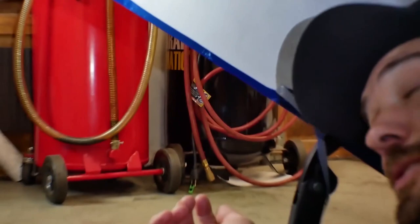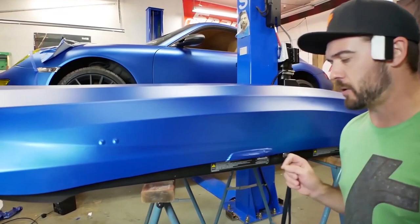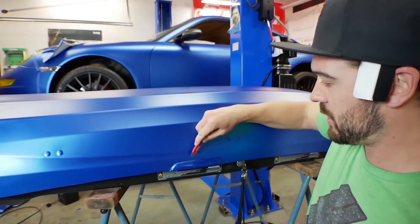That's how you finish it. If you're doing a ski box or any other lips or anything like that, here's a handle — you can't push the vinyl in. Instead, you're going to cut just along the outside. If you score the vinyl rather than press the razor down hard, you actually won't cut anything under it. That's why you always want a super sharp razor. Again, the vinyl shrinks, so heat it up first, then cut just along the outside edge, leaving a small couple of millimeters of vinyl.